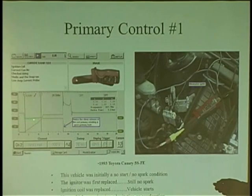You see the voltage trace? It was here, then it lifted up. But look at this. You see this nice release? You have to release the circuit right away, and that creates the induction into the secondary. You ground something and release it right away, you get the induction. That's how you get secondary voltage.